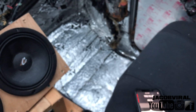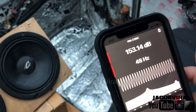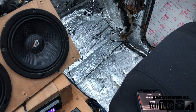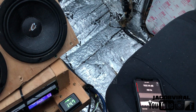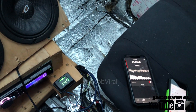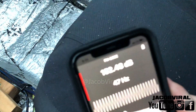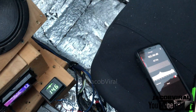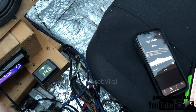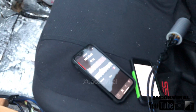Let me do a 47 hertz just to confirm, because before I was doing a 53.6, 53.7, 53.4 — even with the sub a little warm. So instantly I knew I lost. One more real quick. Yep, there you go guys. That was a waste of time. That's just how SPL works — sometimes you gain, sometimes you lose. Sadly that was a loss. So I'm going to have to go in and put that 45 back. That proves to me that 45s can help an enclosure — not only help, but in this case it helps. I was hoping for a gain, but I had a loss.